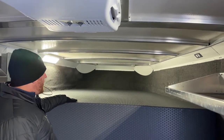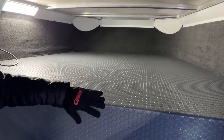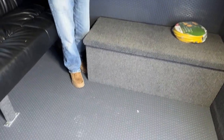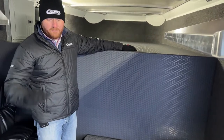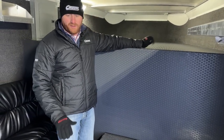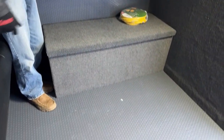Got a light up in the gooseneck deck. We carpeted those walls. You're going to notice this gray rubber flooring — we did this on the deck, the drop wall, and it continues down to the floor. This is a very popular option we're doing on a lot of trailers today. The reason why is it's not carpet that's going to stain over time or hold a musty smell. It's really easy to clean, cut to fit, and they silicone the sides for a really nice fit and finish. We're incorporating this on show cattle trailers and horse trailers into their tack rooms as well.